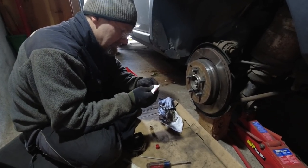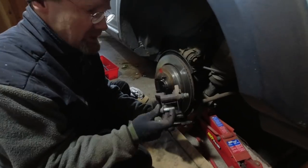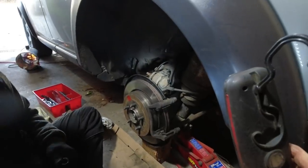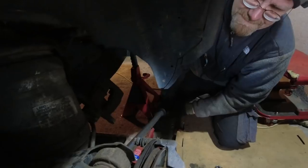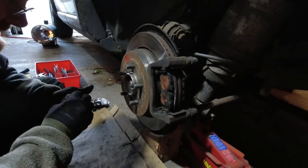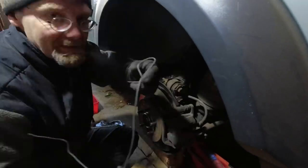I put this plug on with silicone. We fasten the caliper mounting bracket and tighten these to 150 newton meters. Brake pads — install them in the same spot as they were originally. Apply a light coat of high-temperature grease and then put the caliper back in. Caliper mounting bolts: 35 newton meters.